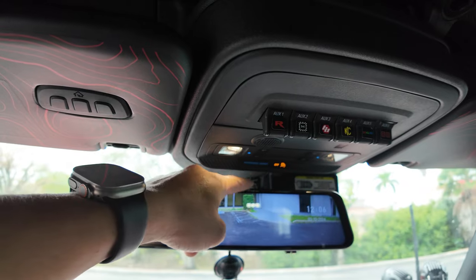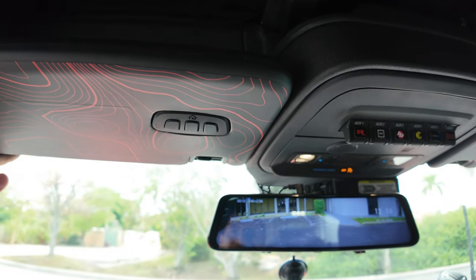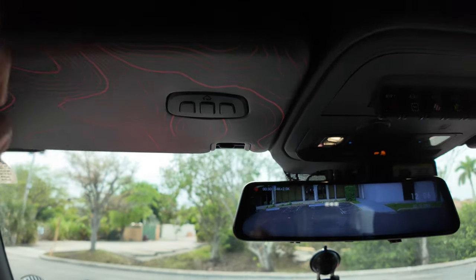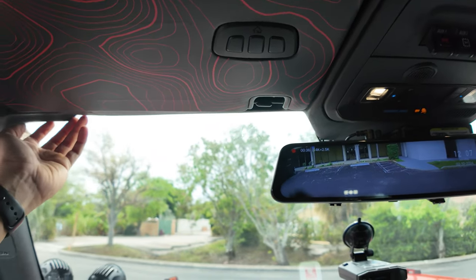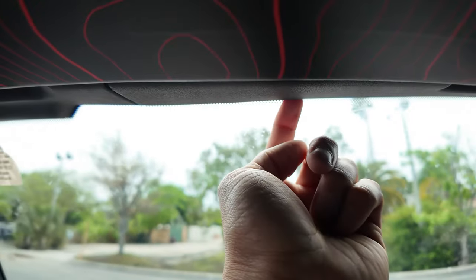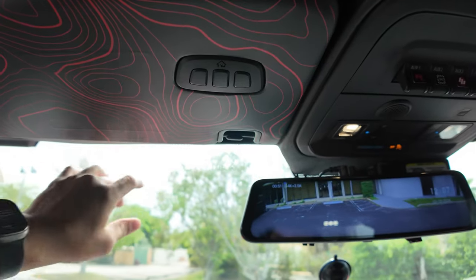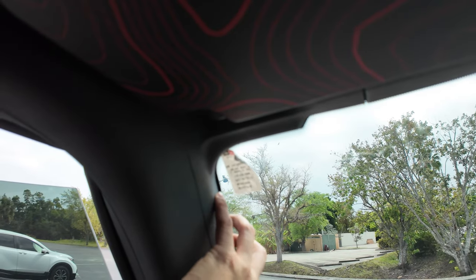As you can see there are actually three cables up here. One is GPS — all these cables are going out the driver's side. There are already a bunch of videos on the internet on how to install these in the Bronco application. One of them said you had to remove all this trim, and honestly you could and push these wires even further, but if you get right under here and use the trim tool that comes with it and start to peel this back, you can put all three wires up in here. They'll start to fall down, so you've got to give them a little slack and push them into the A-pillar so that it retains that slack.